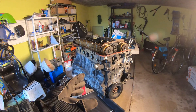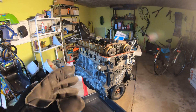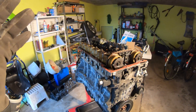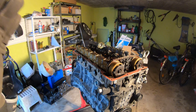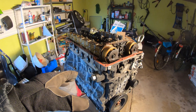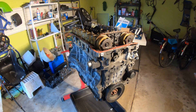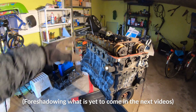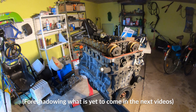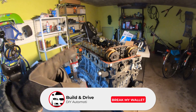That's pretty much all the main oil leaks you can get on an M52 — if I missed one, let me know in the comments. I hope this is helpful to keep your engines running good and not leaking oil, because the oil dipstick is not very precise and it can be challenging to get an accurate oil level. Sometimes you can have a pretty bad oil leak that runs the engine dry and you end up blowing it — normally piston six, because it gets too hot in the back. I've seen that a few times.